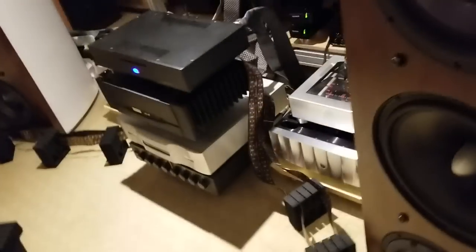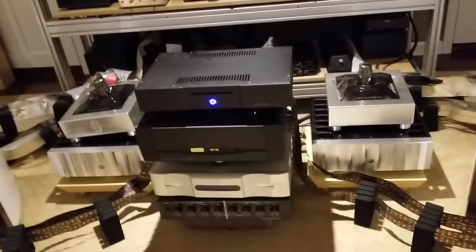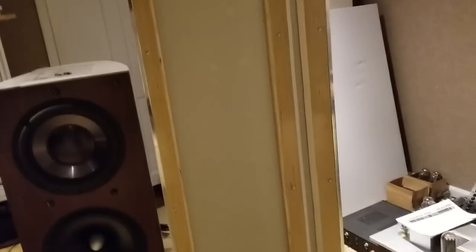The last time I tried the quad amp, I blew both tweeters because I didn't have protection in, and I just turned the thing on and it made that little snap — the little tick it makes when you turn it on sometimes — and it took the tweeters out. So I replaced them, and while I was replacing the tweeters, I figured why not redo the whole thing and put a nice new baffle on there made out of nice plywood, put some polished aluminum caps on the sides, and turned it into a piece of beauty. And actually you would not believe how much better they sound — way better, a lot more bass.